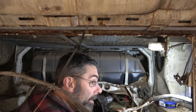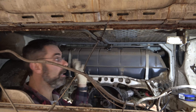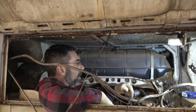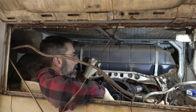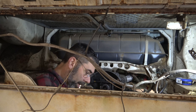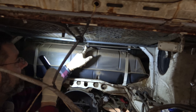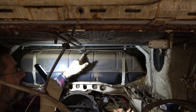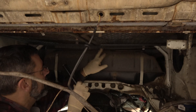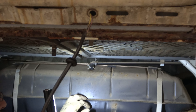Some of the stuff we're going to do while we have this out — once I take the tank out, I have access to the back wall of where the Z-bed folds up and down. Some of the modifications involve drilling some holes through that because we need to bring our new wiring harness down. I don't really want the harness going through where the tank is because then we'd introduce fumes inside. The second I opened this up, I started to smell gas fumes. There's our vent line and it's cracked from 50 years of sitting here, so I'm going to be replacing stuff like that while I have this apart. These lines here look okay, but that big vent line is just leaking and I'll need to fix all that stuff up too.